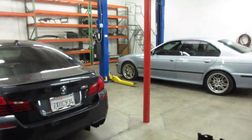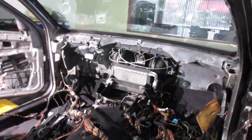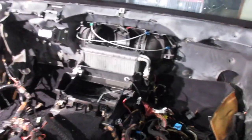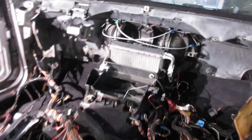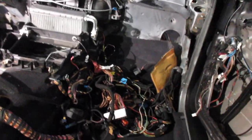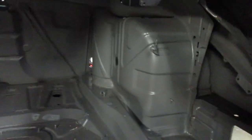It's another weekday and I'm at the shop. The impossible steering column turns out is possible - I got it done. I also got the top of the heater core box removed and the heater core itself. Those three lines are full of coolant and the other ones are full of AC freon, so I can't open that until we evacuate the system. Look at the wiring in here - there would be hundreds if not thousands of miles of wire.